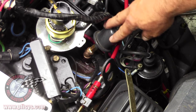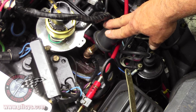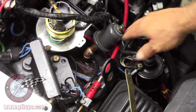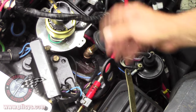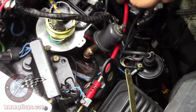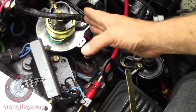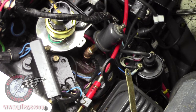This sending unit is quite large. This boat is a little bit older — I believe this is an '88 boat — so we had to put that on there. The distributor is in. I basically marked all the plug wires when they came off, and I pointed the distributor rotor where it was when I pulled the other distributor out.